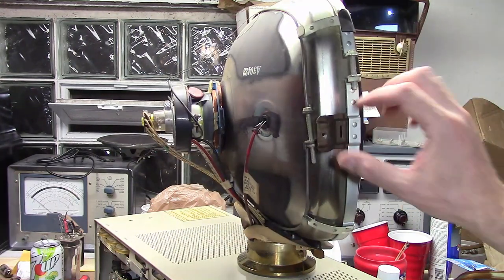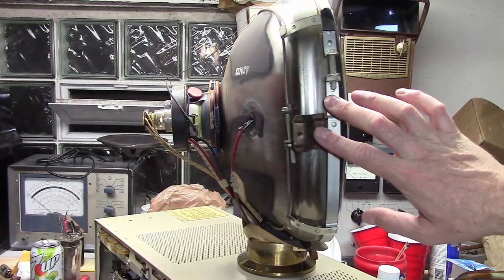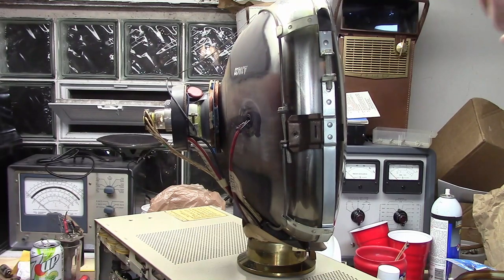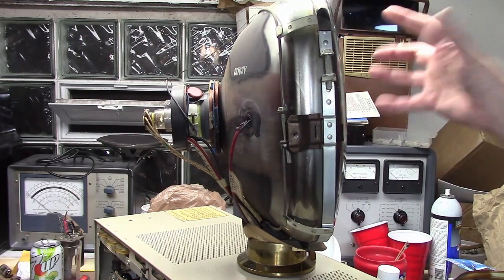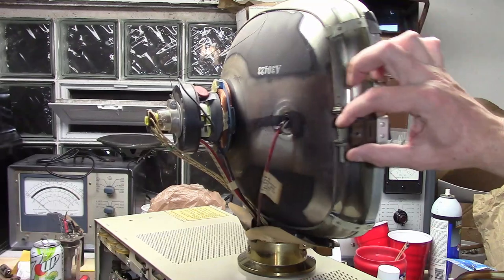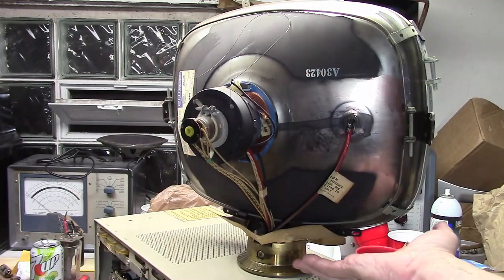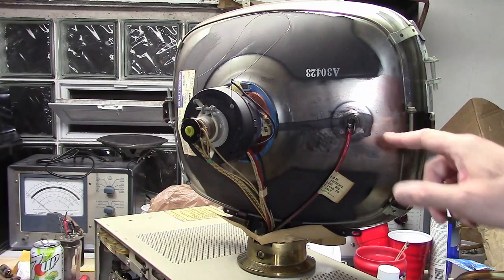What I didn't realize is you can take this apart while it's still mounted on the TV. It's not as easy to do, but the same basic process: get your fingers underneath the decorative band, pull it off, undo the two screws, take off the spring steel band, remove the front cover, take off the two Phillips screws down in the front, take off the two side screws, and the whole back comes off. It's still connected — I can run it like this, and I will in a moment. But first I want to clean it.